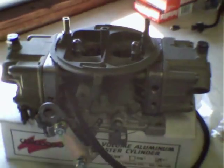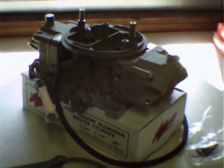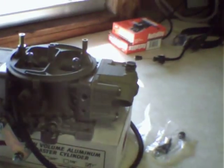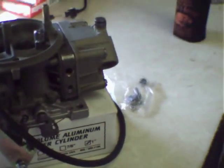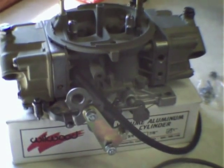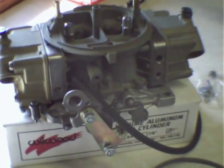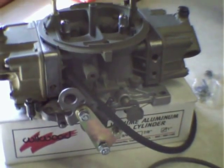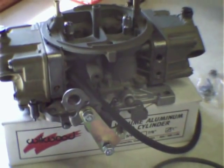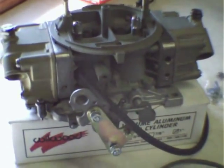On the workbench there's a Holley 750 double pumper that's going to go on tomorrow. I need a fuel line because it's a double inlet, and believe it or not these parts are getting kind of hard to find — you used to be able to go to any parts store and pick them up. This is a boost-reference power valve, meaning the vacuum signal is taken from below the supercharger, not above. That way there's no chance of the valve seeing a false vacuum and leaning out, which would damage the engine.